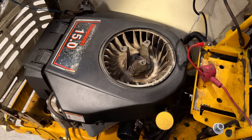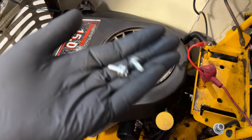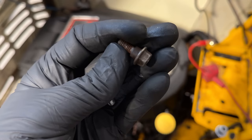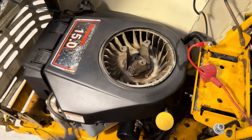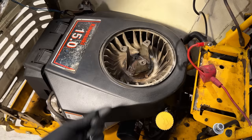You know, for now, I don't think these are immediate issues, but what is kind of an issue is these bolts. I was missing two, so I ordered two new ones. And the old ones had a shoulder on it, and the new ones do not. And they're also shorter. So yeah, we're gonna have to be careful using those. The shoulder makes it so you can't torque down too tight and crack the plastic. So we'll use these for now, but the two new bolts, we're going to have to go pretty easy on them and at some point circle back with the correct part.